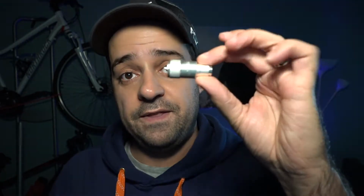All right, so this thing is massive. Whether it's this or actually on the cable itself, I don't want to be drilling a hole this big going through my firewall. I want to try to make it as small as possible. So I will be cutting the coax cable, drilling or finding a spot to run the coax cable through the firewall, and then making my own connection. And then once the cable is run, I am actually going to be using a double-sided hook and loop or Velcro to mount my brother's CB into the truck.